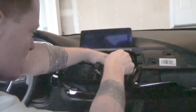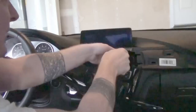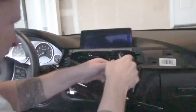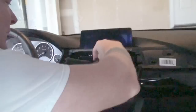Taking photos for the guide as we move forward. Always be careful you're not scratching up your dash. I normally would have a towel over the top of my controls right there. The first screw is out. The other thing that's kind of nice is if you have a tool that's magnetic — you've got to be careful where you put magnetic tools, but it's kind of nice for being able to get parts out. I also have a magnetic bowl to help keep track of things so I don't lose parts.